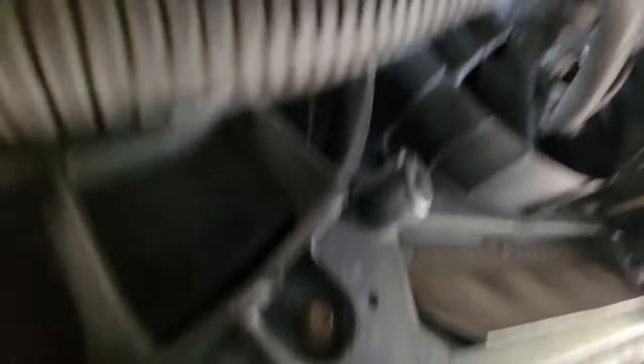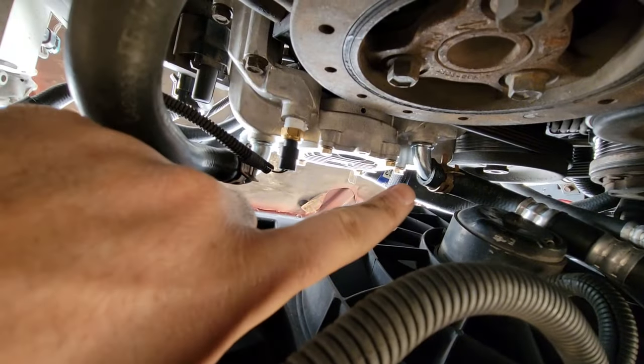You can get hose clamp tools on Amazon — you don't necessarily need them, you can use pliers as well, but these make everything extremely easy because they lock into place. Rather than pinching and having issues with slipping, these do a great job of keeping it contained and locking in place, saving you time and energy. We're disconnected here and we'll be disconnected here. This hose I'm going to remove carefully — it might split, and if it does I would just replace it. Then we're going to go down below and use that same tool on the hoses on either side, then remove that connection and we are good to start working on the bolts.